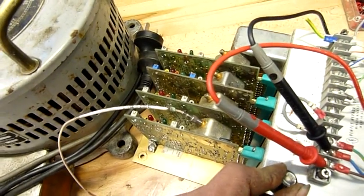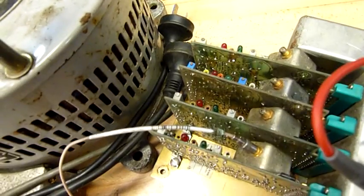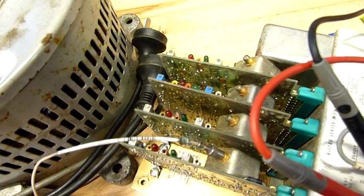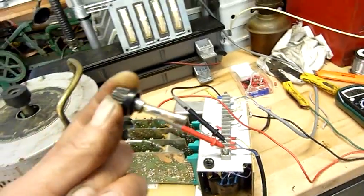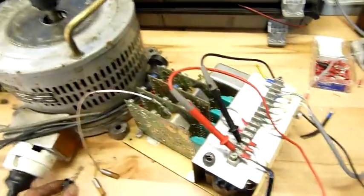I did check the fuse. If I jiggle the fuse enough you can see the relay clicks out. I don't know if it's a bad connection, or maybe the filter capacitor in there has died and dried up. There's a fairly big filter cap for what it is. I wonder if that's dried up and dead - it's just not behaving itself.